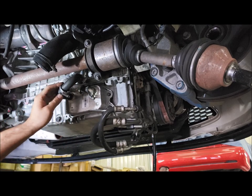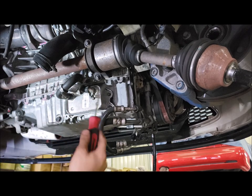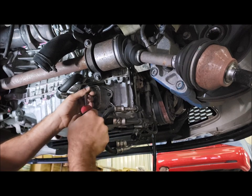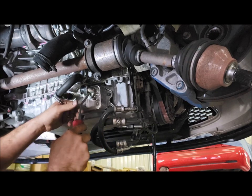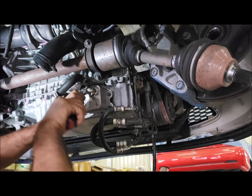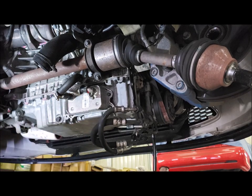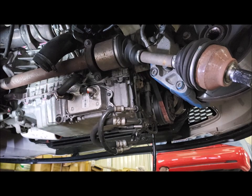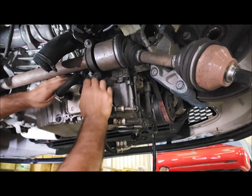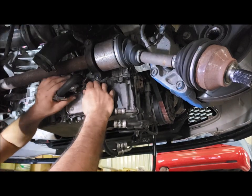These hoses are especially lined with silicone inside to take the heat. With your hose pick, just slide it up the inside of the hose and work it around to break the seal. As soon as you see a little drip of coolant coming through, you know you've broken the seal. Work it a little bit further forward, then position your container to catch it. It's also wise to grab a rag, and you just want to slide the hose up.